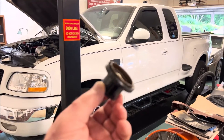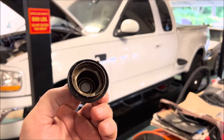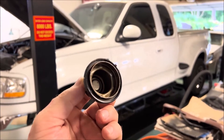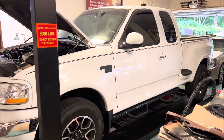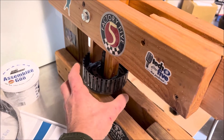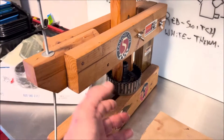Number two: the next possibility could be shift accumulators. There are four of them in there, and I need to drop the valve body to do this. It's a lot more difficult than the shift solenoid pack. I've understood that a broken clip that holds these in could actually be jamming up the valve body, so I probably want to check this as well. Number three, the most catastrophic possibility: the forward direct drum could be bad — it could have cracked and will just spin freely. If this is the problem, it's definitely catastrophic — a total rebuild, or at least you've got to tear it down and replace it.